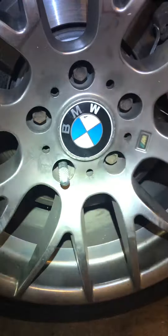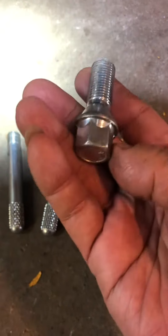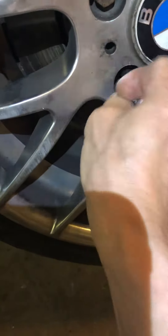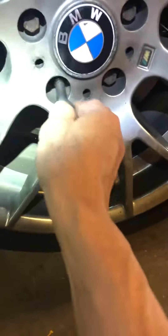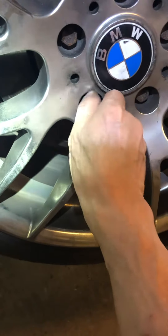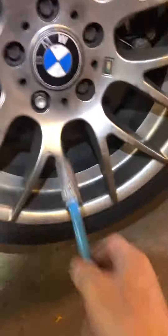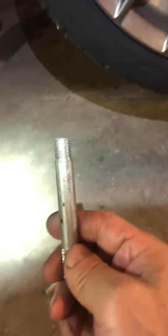So when you have this tool, it's so easy — you hook it up, bang bang bang, finished. For Mercedes it's a little bit bigger thread, and this size is for BMW — look, the thread is perfect. Once it's in, remove this one and thread in the lock, then use the 100 pound-foot torque limiter to tighten it. That's it — this is good stuff, you gotta have it.